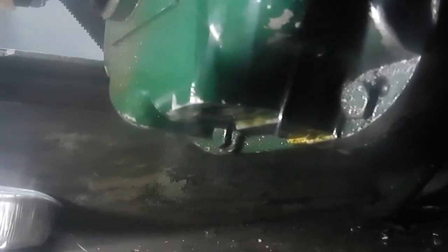This is the tricky bit — left a bit, right a bit. Both the sump plug and the dipstick have copper washers, so you do need to be careful to put those back and don't over-tighten — I'm paranoid about ripping the threads out.